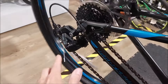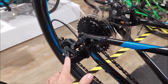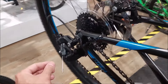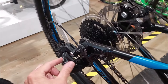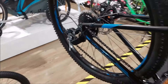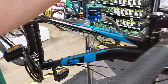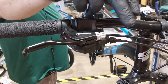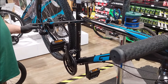Is this an auto shift? It's Micro Shift — that's the brand. It's actually a sub-company of Shimano, so it's a good brand. All shifters and derailleurs will have this adjustment option 99% of the time. Some will also include an adjustment point at the derailleur itself, though not all do.